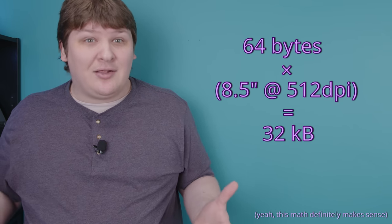We've got two Silver Reed Portocopies, a CopyJack 40, a Sharp Handy Copier, a Panacopy Mini, and a Sony Pocket Copier. We'll start with the CopyJack 40 since it came out the same year as the Portocopy. It's from 1986 as well, but it's smaller and it's blue. It has the same basic layout as the Silver Reed with the paper at this end and the printer-scanner head at the other. They've also moved the paper release to the side, and it now has a button for activating it instead of just being able to press it against the document, which is worse. The only other major difference is that they've removed what appears to be a crucial component - the rubber roller is gone, so how is it going to advance the paper?